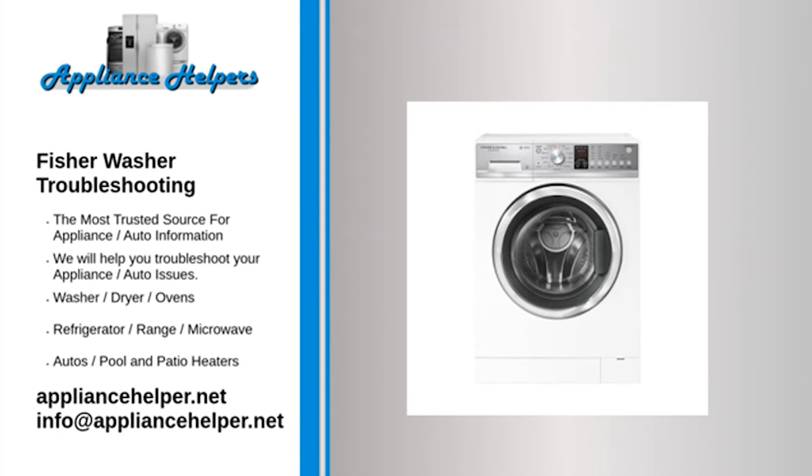The washing machine is filling continuously: Check that the drainage hose is positioned in the standpipe or tub. Check that the standpipe or tub is at least 800 millimeters above floor level to avoid siphoning. The rinse cycle isn't working properly: Check that you are using a low-suds, front-loader-specific detergent, and not using too much. Check that the wash load is distributed evenly, and try the machine's rinse-plus function. The washing machine isn't spinning properly: Check that the load is distributed evenly, and that the machine is not rocking; adjust the feet if necessary. The machine is producing too many suds: Check that you're using a low-suds, front-loader-specific detergent in the correct amount.